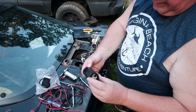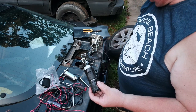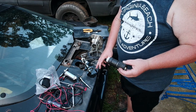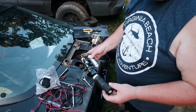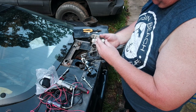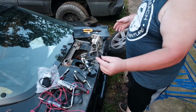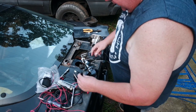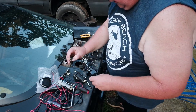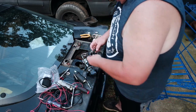Fuel pump's out. I'm going to take all this rubber and put it on the new pump — this keeps it from vibrating and making lots of noise. Don't worry about the paint on this; the clear coat's already shot. This did come with a new piece of hose so I'm probably going to use that — this one seems pretty shot. I'll go ahead and reuse the clamp since there doesn't seem to be anything wrong with it. As you can see, it's a little nasty — they replaced this pump at one time but didn't replace the hose.